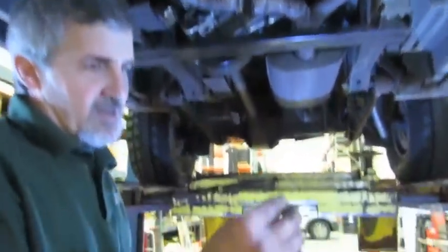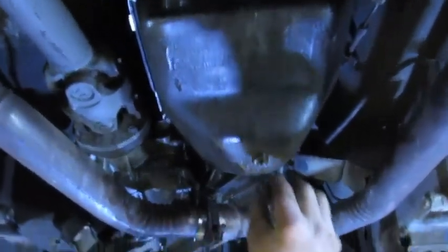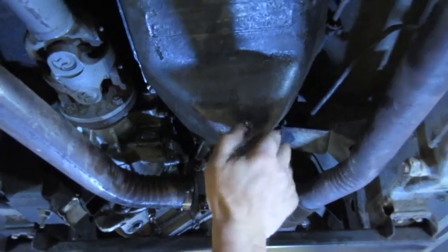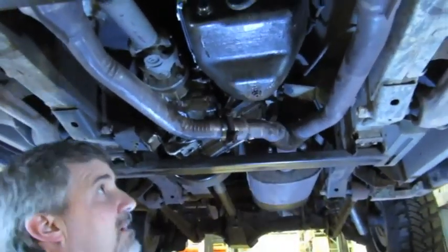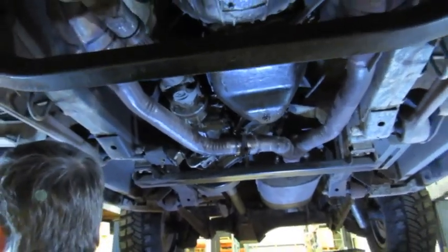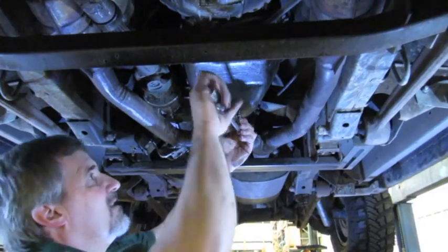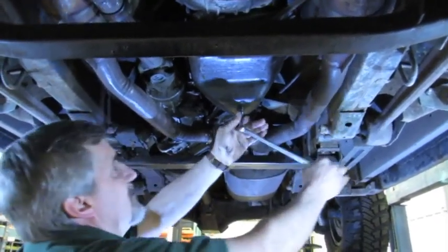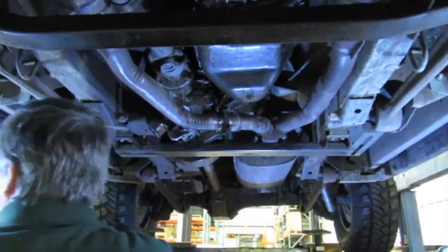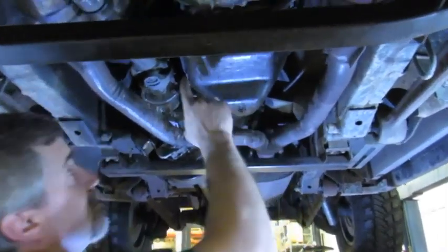As you saw, we got all six bolts in place. Run them in until snug and then about a quarter turn should tighten them down. They'll get tight because these blocks act as spacers so you don't squash the gasket — they're like an auto-stop, so don't worry about over-compressing the gasket. Last but not least, clean up the area on the bottom where the drain plug goes, install the drain plug with its new gasket, and lock it down.